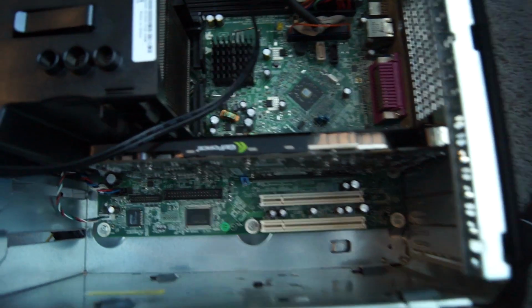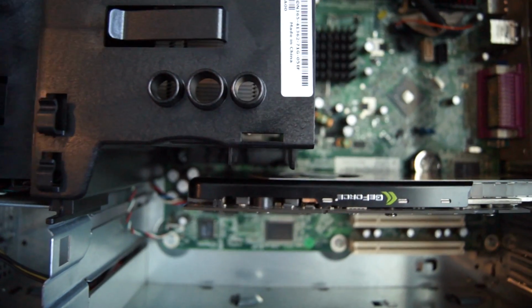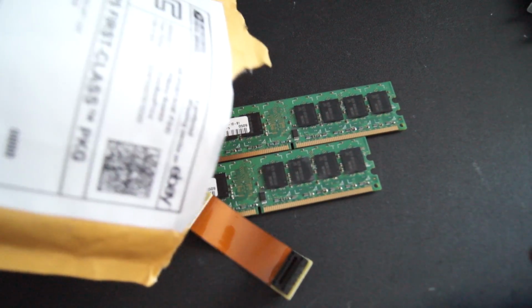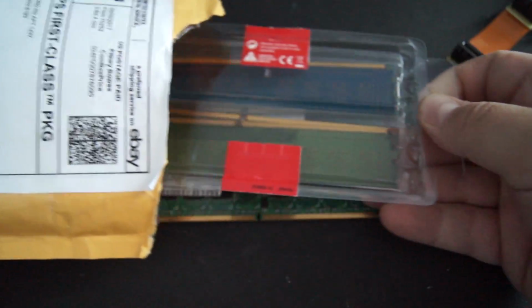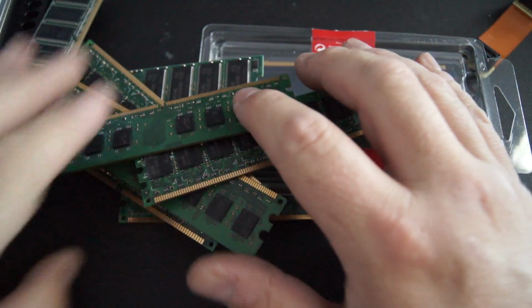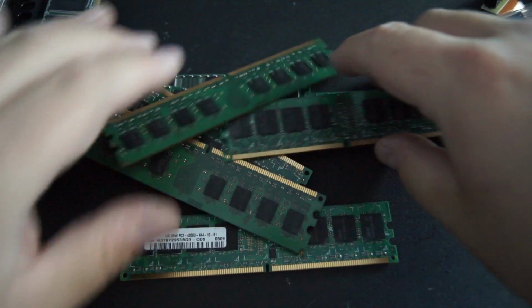The memory ended up becoming an issue as well. It seems this motherboard does not like 4GB of memory. The PC would blue screen of death every time when using 4GB of memory, or even 3GB of memory, with 2 sticks. I tried multiple sticks in multiple configurations, 533 MHz and 667, and I ended up sticking with a single stick of 2GB 667 MHz.